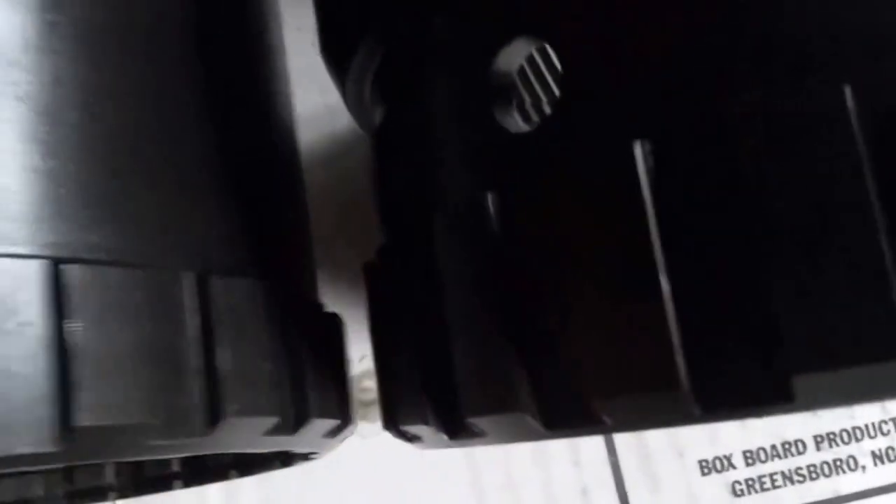A little bonus information: there are things you can notice like the holes in the ring gear for the 4R70W where the snap ring goes — looks quite a bit different from the AODE. You can see more light right there. So notice where the snap ring goes for the AODE and how it differs from where the snap ring is for the 4R70W. There's also a difference in the width where the speed sensor reads — it's much wider on the 4R70W than it is on the AODE.